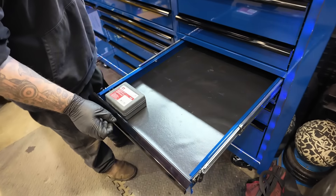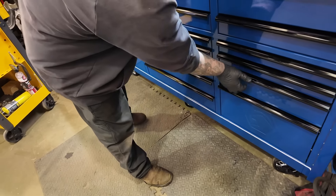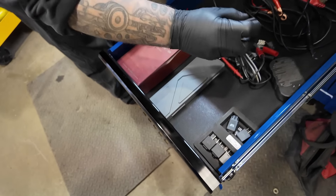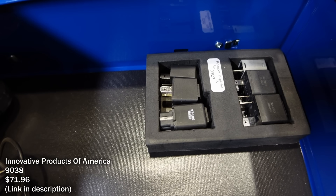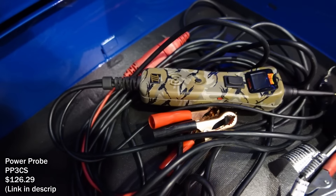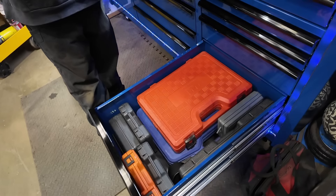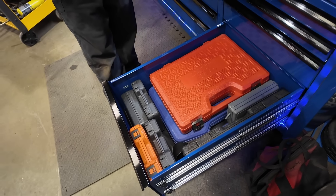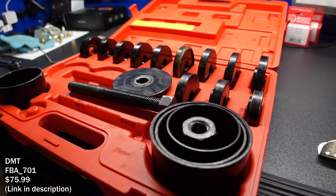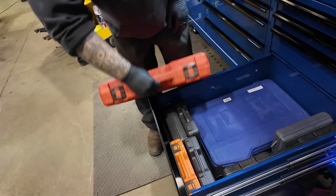Some more empty drawers — I just got this to expand. Bigger stuff's in there. Electrics — multimeter, fuse relays. You can just cut the circuit on. That's cool. Like run the car for the fuel pump or something? Yeah, just to see if it's getting power from that circuit. Power probe — you use your power probe much? Not as much as I used to. Power steering pump pullers, pulley pullers, ball joint kicks. This is a bearing puller — you're going to do it right in the car.